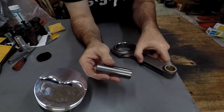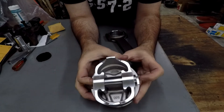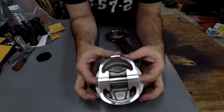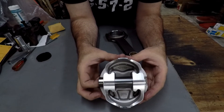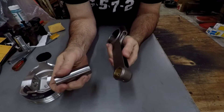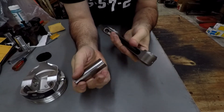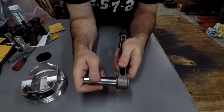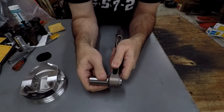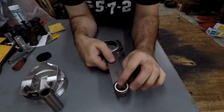To put these together it is a floating pin and they just slide in inside there. It should be a loose fit — a loose sliding fit — should have no rattle, no chatter, nothing like that. It's tight in that direction but slides very easily. The rods are bushed and they need to take these pins the same way. You can see that one's a little tight — it goes in just a little on one side, gets lined up, slides in stiff, and going out the other side it gets a little tight. That's not going to work out too well.